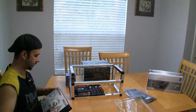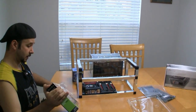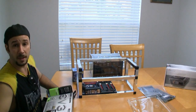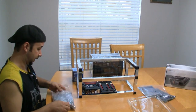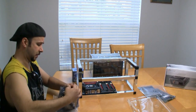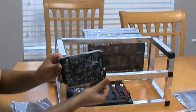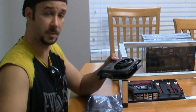You can see how we're going to mount the board into the rack. Let me open up one of these GeForce cards so you guys can see what they look like. These perform extremely well — they're great with power efficiency and you still get a really good hash rate. NVIDIA really stepped up the game with these Ti series cards, and you can't beat the price; these guys on Amazon are about $159. I'm going to set this up to mine in Windows and do a comparison with Linux, so you can see ease of use versus performance. Nice heat sink on it, and we're going to overclock the fans to make sure they run really cool and don't fail on us, because we're going to be beating them up pretty good.